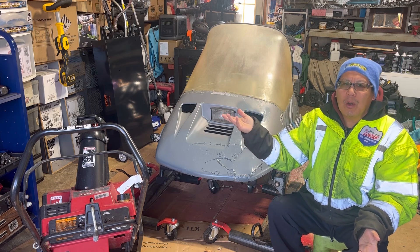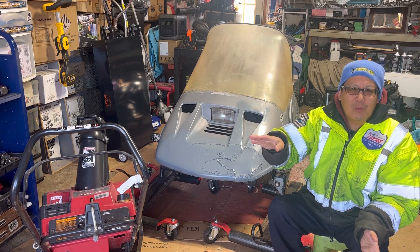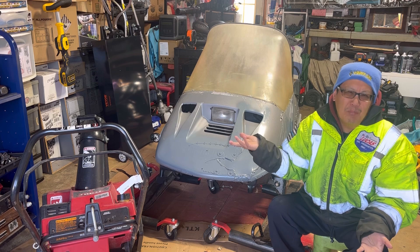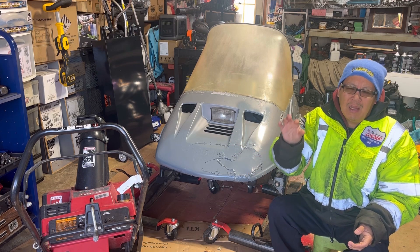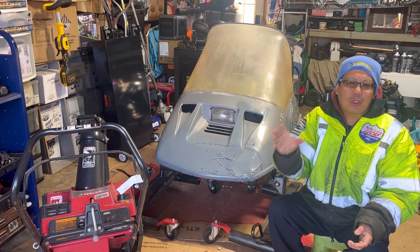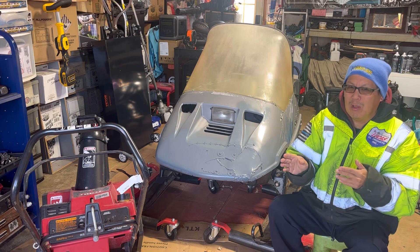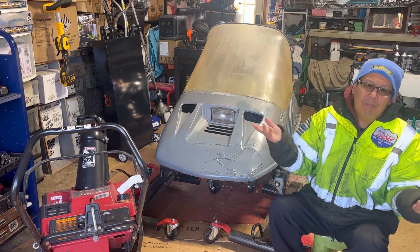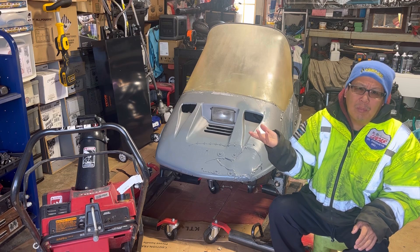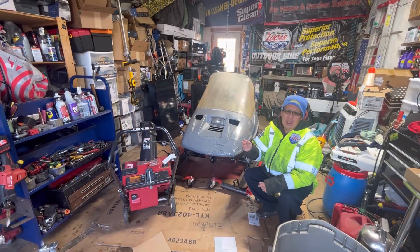Usually you go to a store or a repair facility and they'll plug your tire for about 10 bucks — you tip them five, so 15 bucks total. A hole in your tread is really fine. You don't want a hole in the sidewall because that's dangerous and plugging won't work — you'd need a patch for that. I've plugged my tires many many years with no problems.